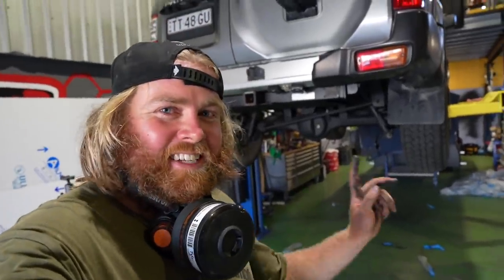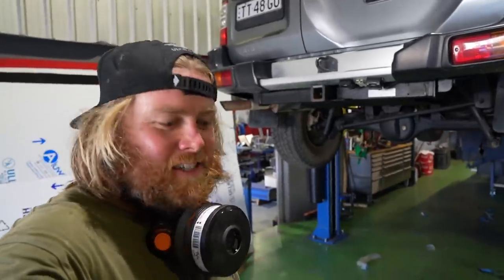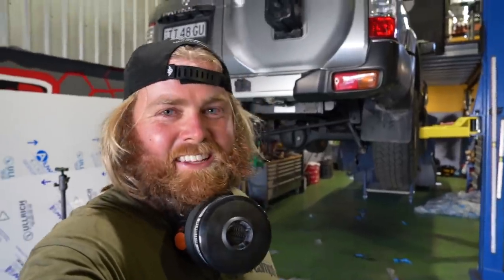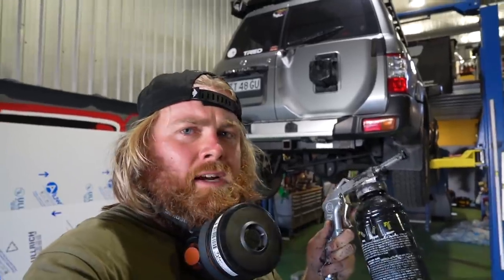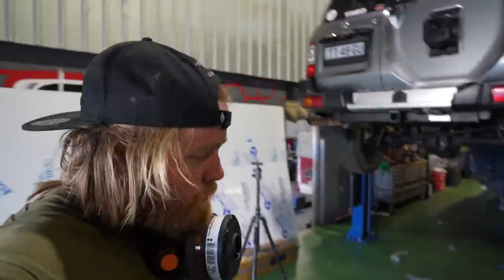That was a little bit of a mission, but we're done. It looks bloody amazing under there — so much nicer. Everything's all a nice black now, and it's all nicely protected and rust-proofed under there for the beach driving, bush driving, and everything else I'm going to be doing. Massive thanks to Trent and the boys at G-Works who helped me out. Trent ended up painting probably half of it for me underneath because he's done this a few times before and really knew what he was doing. We were going through together checking for spots. I used the air compressor here at G-Works. We ended up using nearly five litres of Raptor — four litres I had, and Trent had an extra bottle. We were running it on 60 psi on the air compressor and that seemed to work pretty well, just mixing up the bottles as we went.